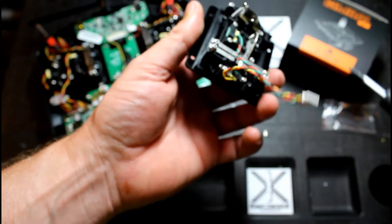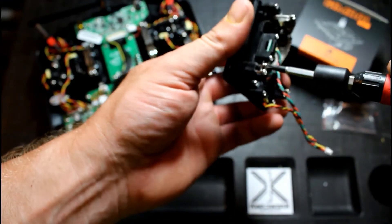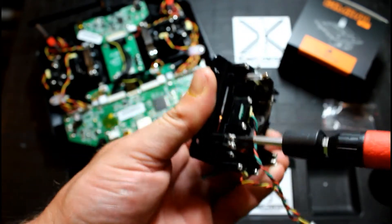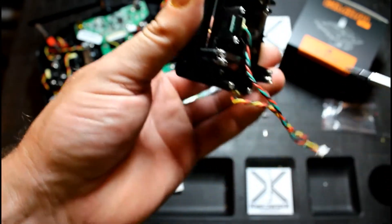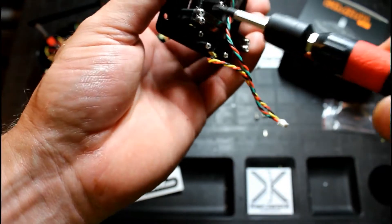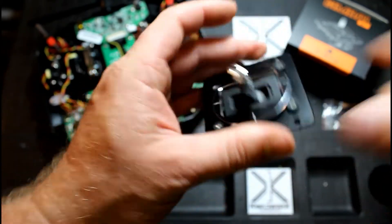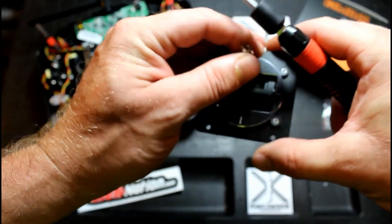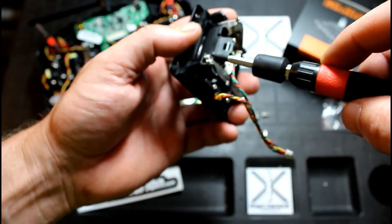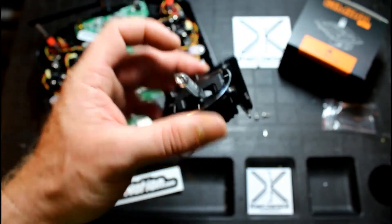Now, because you had the spring tension on there, there's actually no band tension. So we'll take this band tension, just turn this screw here, we'll turn it in a bit until you get the proper, or your desired, tension on there. That feels pretty good. I'll give her just another little turn there. Yeah, that feels good. Alright, we'll get to it.